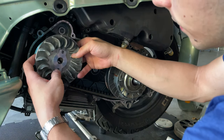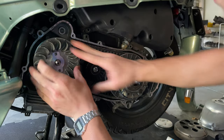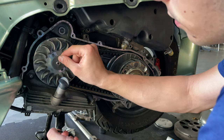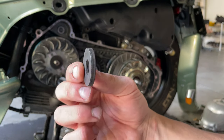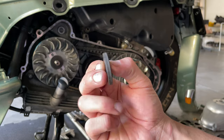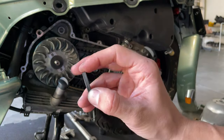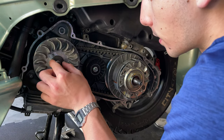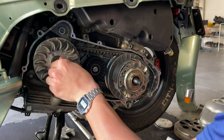And then you wanna slide this in. In there. And you got two washers, remember? You got the flat one, it goes all the way flat in there. And then you got this, remember the shape of this one, it goes into a certain position. The part that goes rounder into the inside goes facing in, and the rounded part that is into the outside goes facing out like that. Okay? And you wanna pull those two and bring your new nut, get the starter.